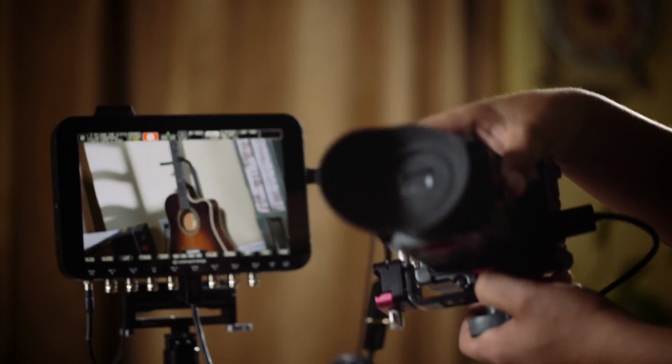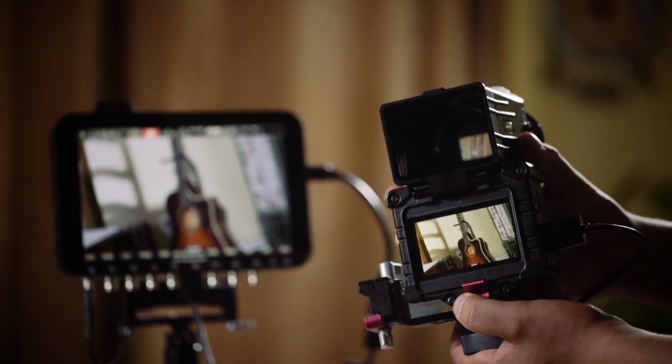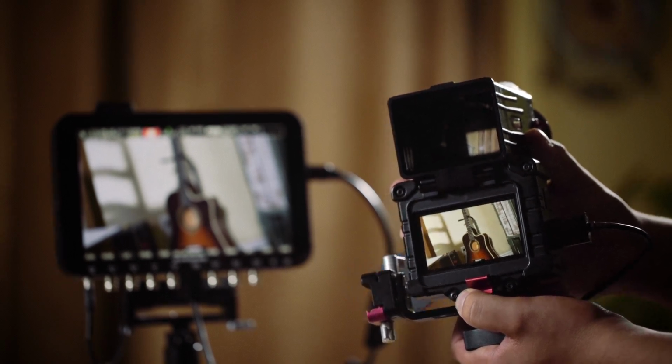If you're going to be recording in 4K, say this is on your camera and you have, let's say, an EVF. Well, I don't know of any 4K EVFs yet, and it's going to require an HD signal. So you can send that out, whether it be SDI or HDMI. Also, how about maybe a director's monitor? You can plug that in and it will also feed that HD signal to a monitor. So it's a great option, good to have, because I think we're still going to be using HD monitors in the field for quite some time.